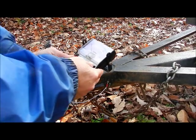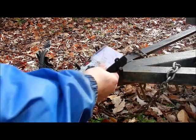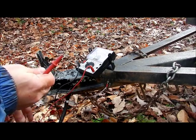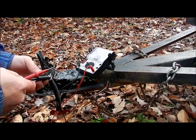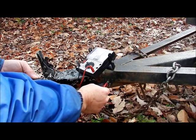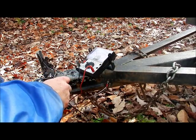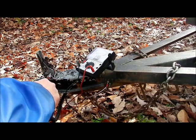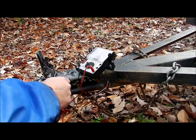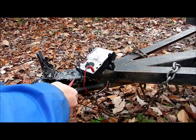The next thing we want to do is set our meter on the resistance scale — I put it on RX100. We're going to check our ground. If we have a loose wire, the ground is going to be the white wire. We'll stick our meter in that — it doesn't matter which probe, because there's no electricity involved. We're going to hit the screw and we have continuity. I'm also going to take this and go to any part of the bare metal on the frame of the trailer and I should have continuity. That verifies I'm getting a good ground to everything on this frame. That's step one.